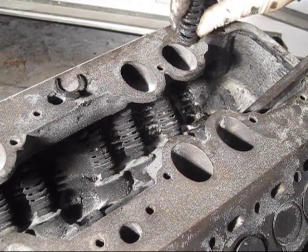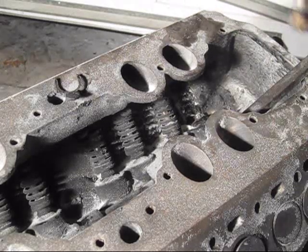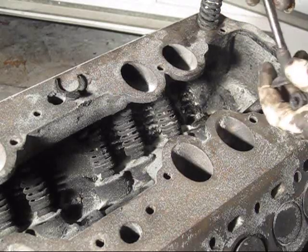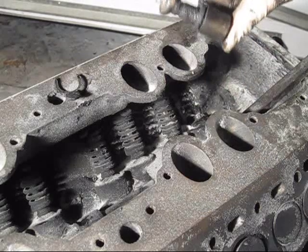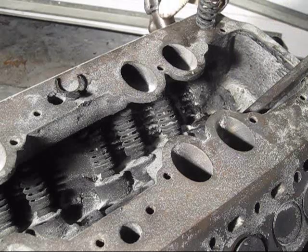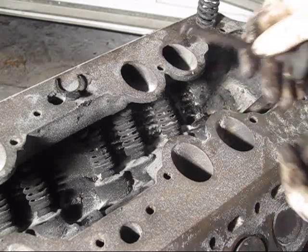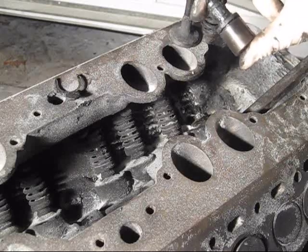Alright, so I'm going to show you how to remove a valve on a Flathead Ford from 1952. This kind of valve extends through many years, but as far as I know, there's two styles. There's one where in the earlier model, this actually had a mushroom on this end, and it had a split replaceable valve guide. This was actually cut in half, and they put it together and slid it into the valve there, and it stayed together, and I thought that was a pretty unique idea they had. But in the later models, they had what is most commonly seen today, and this solid valve guide.